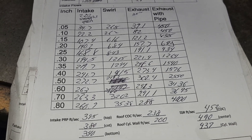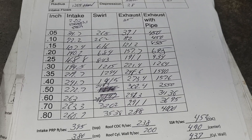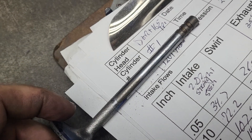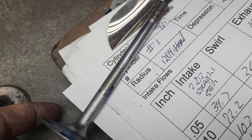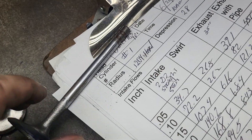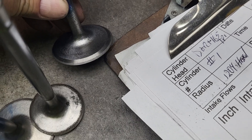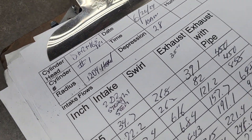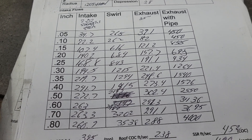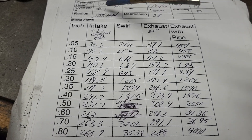I have to do a disclaimer. I went back and started reviewing all the TPI videos and it seems I goofed up day one testing these Darts - completely stock with the wrong valve. I'll show you how you can tell: the wrong valve has a strange wear mark on the stem and it's got a bigger dish. I saw it on the very first one - it also has a good size back cut on it. Sorry about that guys, I have to go back and make a note on every video that it was being tested with the wrong valve, which completely screwed my development up.